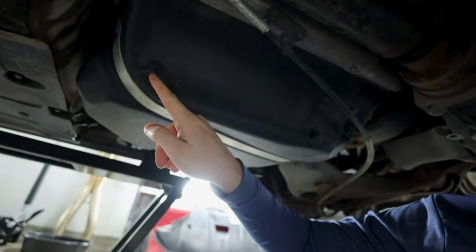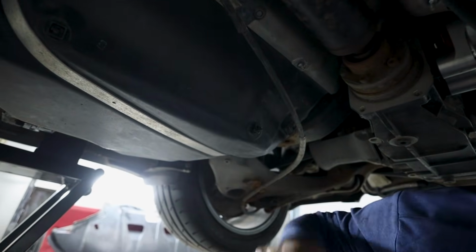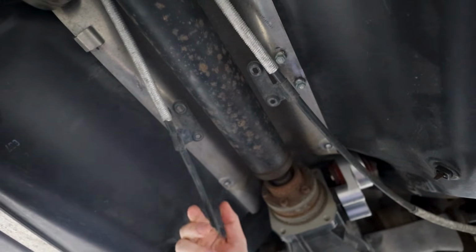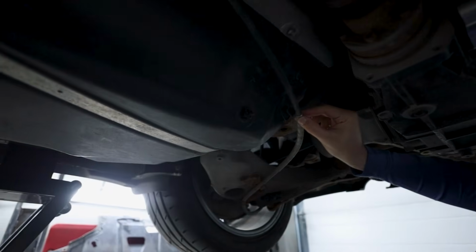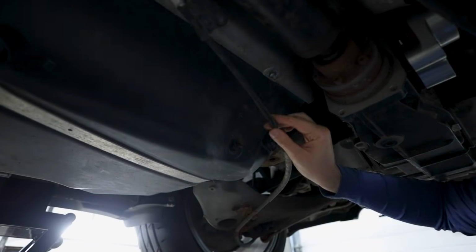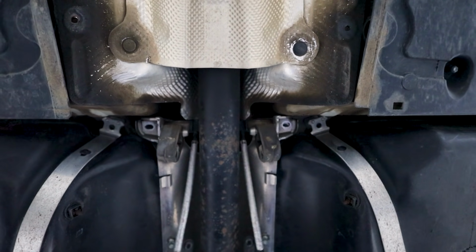Those are the pieces that would normally be right up here by this stud and this stud here. You can just leave them. They're usually wrapped around right here. You will also see that I loosened up my parking brake cables. Usually it's connected by 2 bolts right here and then clipped into the gas tank right here. You also do not need to do that. Just so you're clear on orientation, the front of the car is at the top of your screen.